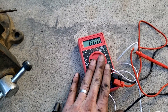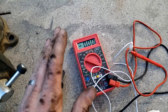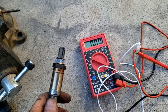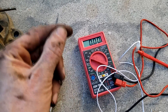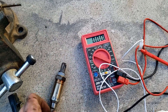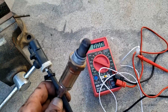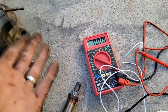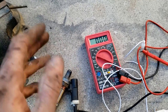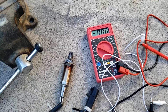As you can see on the multimeter, we did get a response — it was producing voltage based on oxygen levels. It was hard to get a perfect position but you could see it bounce. What you cannot test with this method is response rate — how quickly it adjusts — and I recommend using an OBD2 dongle connected to the ECU to graph that. This is a good manual method if your engine has a really rich or lean condition throwing off readings, or if you don't have a car to test on right now.